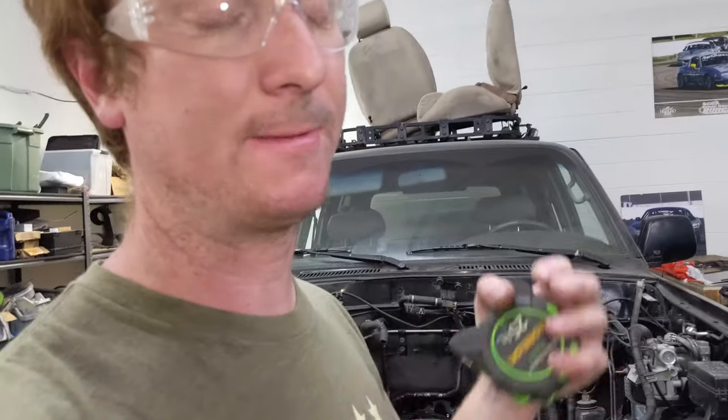I've also got these heavy-duty dense rubber exhaust hangers. My idea is to place them evenly spaced and use them as isolation between this piece of box steel, which will go across the chassis and be welded in. I'll probably put some slots in it for adjustability of the motor position. I may have to swap out the rubber in the future — I was just looking for high-density rubber locally to start working with. Any kind of rubber will work for now, and I'll show you the finished result when it's all done.